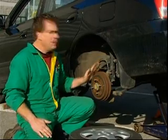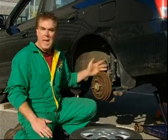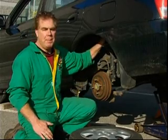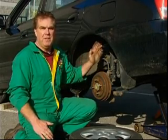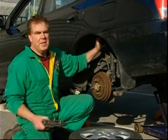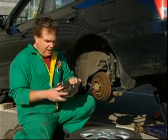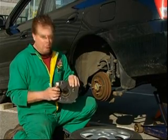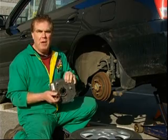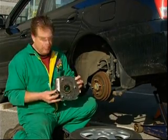And when you lift the vehicle up and you look under there, you may not see anything that looks out of place, worn, or damaged. But when you go to the top end of the strut and remove the strut from the vehicle, you'll see the problem. Now, the strut on this Elantra is still in there. There's nothing wrong with it. We're just using it for a frame of reference. But there's an example of one of these upper strut mounts that wore out. Now, this one came out of about an '02 or '03 Chevy Impala, a GM W-body car.